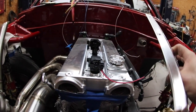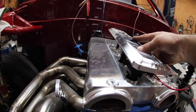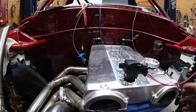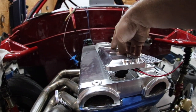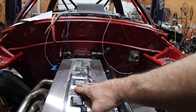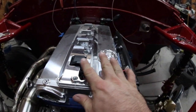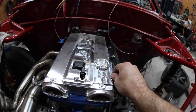With the coil-on-plug plate in place, you need to tuck this wire back, but you can see there's no way the unmodified coil would ever go down — that's what you're trimming the boot for, and the spring ends up just being super long so you cut that too. With the ignition coil out, my valve cover is just loosely sitting on here but it isn't going to get any higher or lower — that's the fixed position. With the modified one in position, these wires get out of the way and with a little bit of force it does sit down. I want a little bit of resistance so I know it's pushing the coil packs all the way down on the plug for a good solid connection. Make sure you don't smash the wires when test fitting your coil packs.